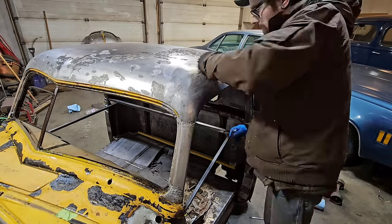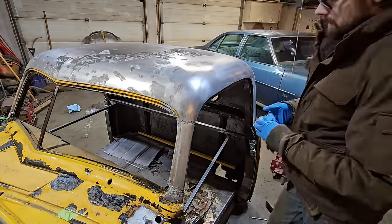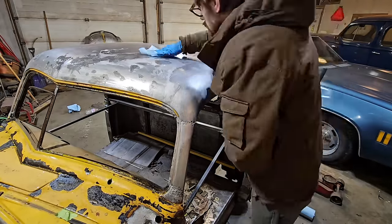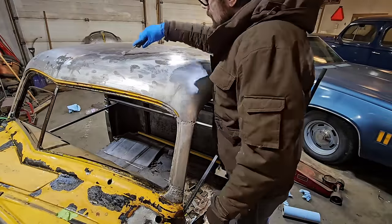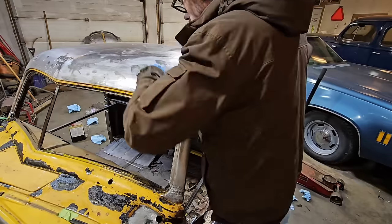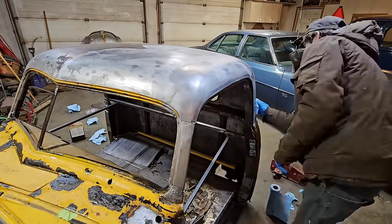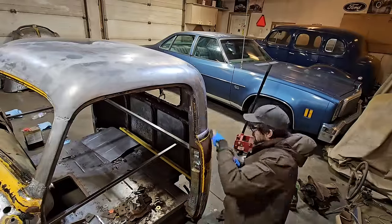Like I said, leaving it on for 2 hours was a big mistake. It just made it very difficult to remove. And I'm not a scientist, but I think what's happening is, as soon as it's exposed to the atmosphere, it starts to lose its bite. So you have to, like the instructions say, just keep removing it and reapplying it as needed. I did notice that the spots where I had actually removed and applied the stuff several times had a lot more rust removal action than when I just left the stuff on for 2 hours. So that kind of confirms my theory there.